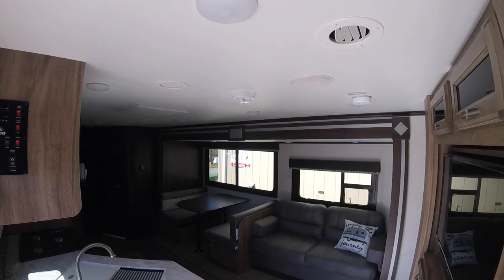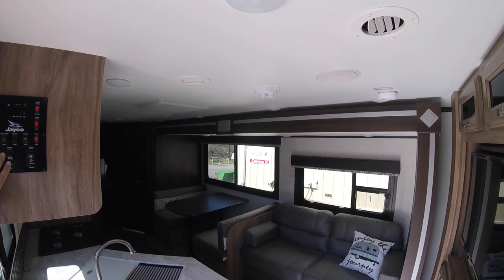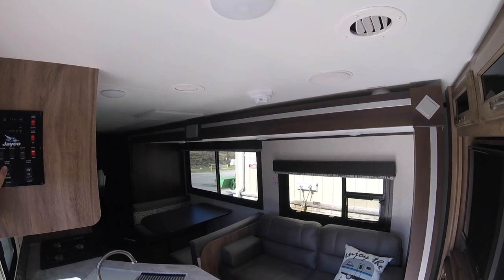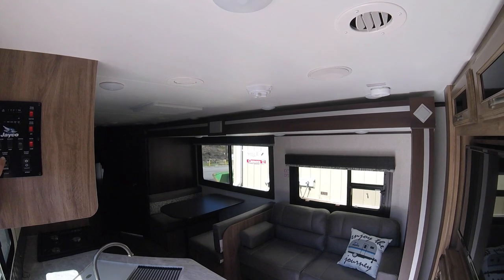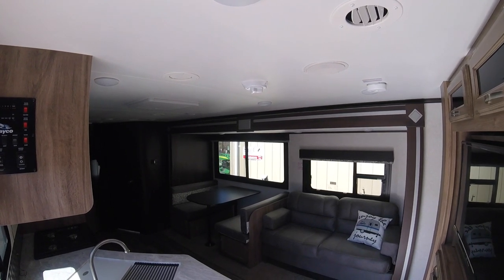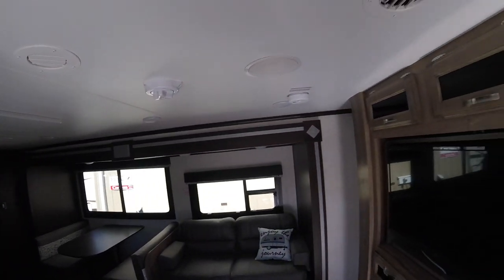You have your slide in and out. The slide does go fairly quickly. When it comes in, you'll hear a clicking sound — that means it's all the way in. Same thing on the way out. The slide only seals when it's all the way in or all the way out, so you can't leave it halfway — otherwise it won't seal and you'll have water or rain coming inside.